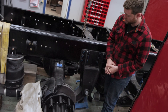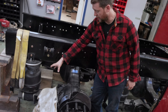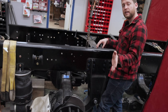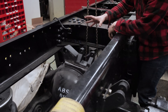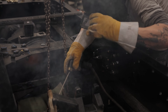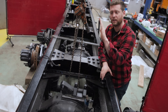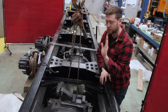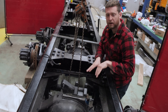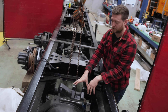We are at the stage of manufacturing. We got the new AAD suspension hangers placed, got the airbags on, and slid the axle under it to get it into position. Now the next stage of manufacturing — we've got to weld on these torque rod hangers. The torque rods are what's going to hold that axle in place. There's one torque rod that runs up here that holds the pinion angle, and then we have the torque rod that goes between here to the frame rail. That's going to hold that axle in place so it's not shifting around — this is what holds the axles in place.